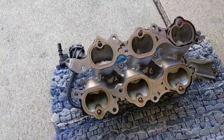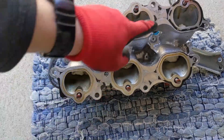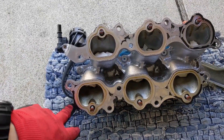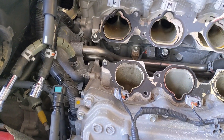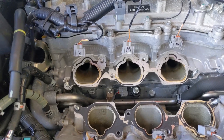Quick note: if you're trying to clean up a little bit of fuel spill, it's recommended to blot rather than wipe. Blotting helps absorb it and get it off painted surfaces — it can eat into the paint. Intake manifold is out. Placing it face down so we don't damage the fuel injectors sticking out the bottom. Something a little weird here — this gasket did not come off cleanly. I have a replacement gasket, which is not the problem; they're cheap and easy to get. But I don't like that it's kind of stuck. You don't want to scratch the surface — there's gasket residue there, and it doesn't look all that great, if I'm honest.